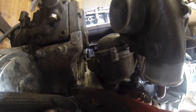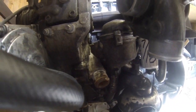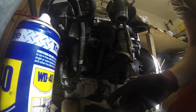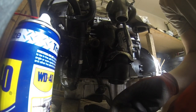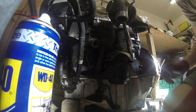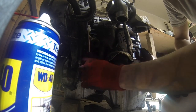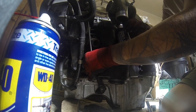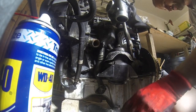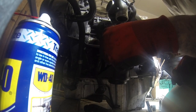So I need to remove all these bolts - in this case under here - and then the pump sits just behind there. I've got four out of five bolts out and the fifth one is very tiny, hidden behind here, however very loose. So what I need to do now is basically try and prise it away, which feels very, very stuck.